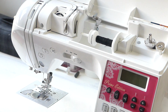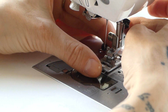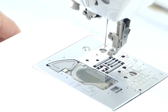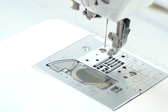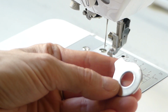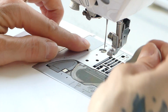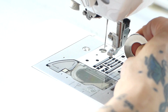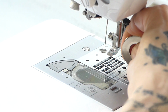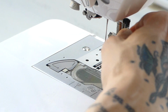Now we're gonna be cleaning the bottom, so I am going to take away the sewing foot, which makes things always better. And now I will grab the screwdriver that came with the sewing machine. That's the screwdriver that you will need in order to loosen these screws, because a regular screwdriver would not fit underneath the sewing machine's arm. And again, we are going to remember lefty-loosey.